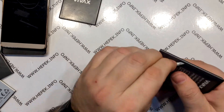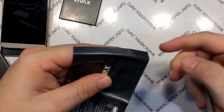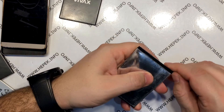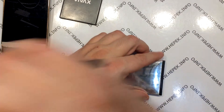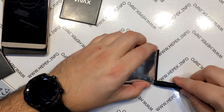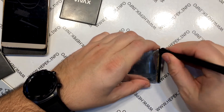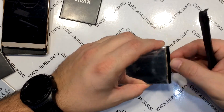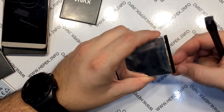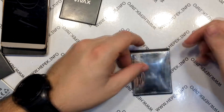Now that I have decided which battery to use, I take the old inflated battery first. I need to remove the label from the battery — I remove it very carefully. The next step is to separate the plastic on which the battery contacts are located. The plastic is usually glued with double-sided tape. It is important to approach this with high caution, because batteries do not forgive mistakes. I use a plastic tool to separate these two elements; I advise not to use metal tools. I carefully and gradually separate the plastic with the battery contacts.